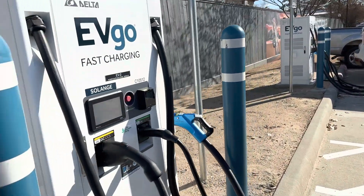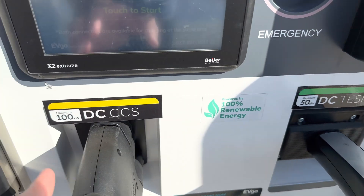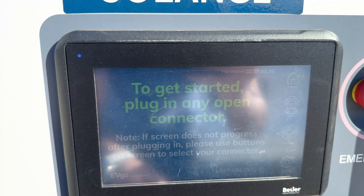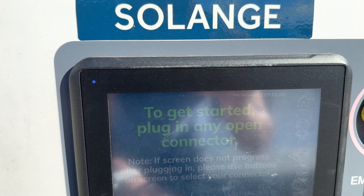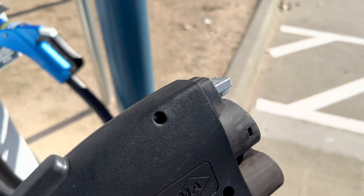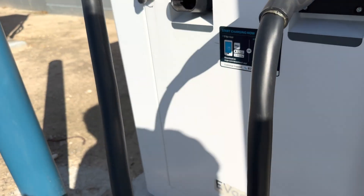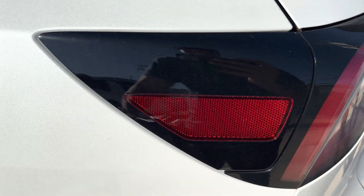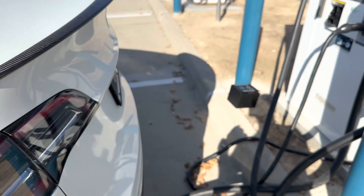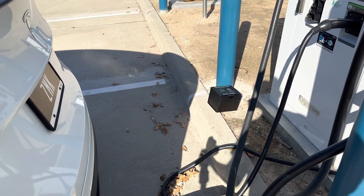Our only bet is to see if this other one is working. Okay, this one is working, so I'm going to use this one. I'm not going to use the Tesla charger because it's just 50 kilowatts — this is the 100-kilowatt CCS. To get started: plug in any open connector, and I'll have to start right here. This cable is pretty thick compared to the Tesla charger cable, which is not as thick because that's 50 kilowatts and this is 100 kilowatts. I'll have to open the charge port by going into the app, because the button on a non-Tesla charger is not going to work. So I'm going to connect the Tesla CCS adapter, which is from EV Basis, and we'll charge and see how fast it goes.